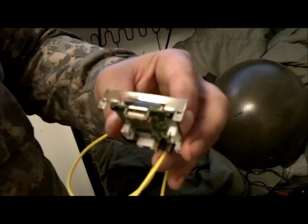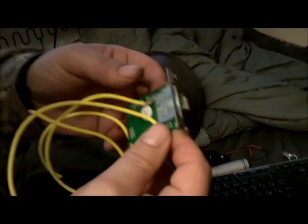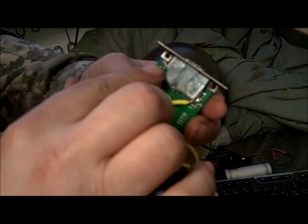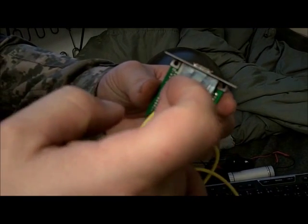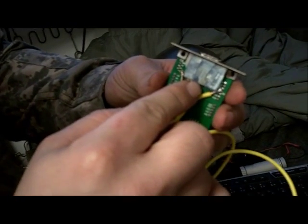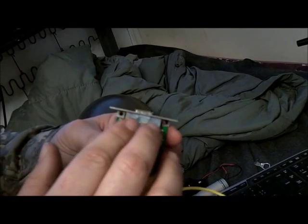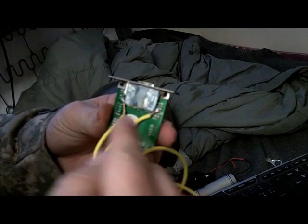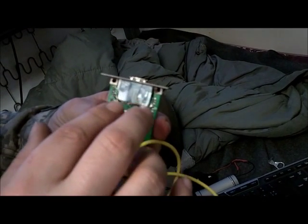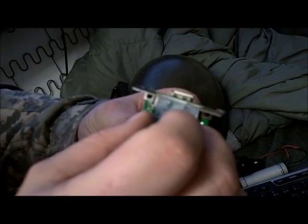We take it out, and on the bottom here, you store your USB and you also have your SD card. We took out these two screws here — one here and one here — took this piece off. When I did that, in the back here, it's encased with a metal case, an aluminum case. We cut out a complete center piece out of the middle of the aluminum. Then I made a plastic top and superglued the plastic on top to keep it enclosed. But now the metal is broken on both sides. At the base of this actual SD port, there were soldering points here and here, which actually fastened this metal case with the actual port to the chip.